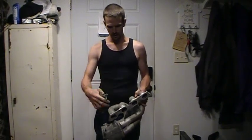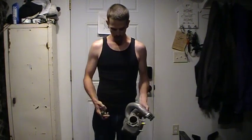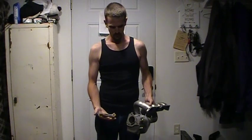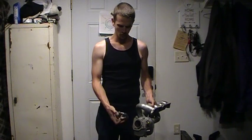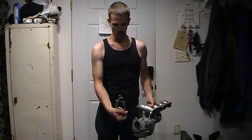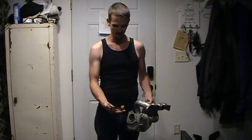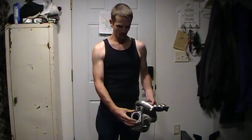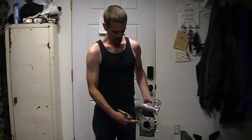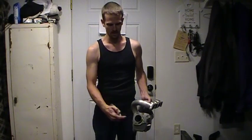Both flanges were lobbed off, the Prius flange was welded onto here, and this should bolt onto my Yaris now. The older generation of Toyotas had a 3-bolt throttle body assembly, and when they moved over to the newer versions that were drive-by-wire, they used a 4-bolt. This was a vacuum port on a Scion or a Corolla. I don't know what to call this part exactly — I ripped this off of my Scion parts car — and we're gonna put this somewhere in this spot. We're gonna lob this off so it's a gaping hole, then weld this on so it's the proper size for the larger throttle body, because that's too small.